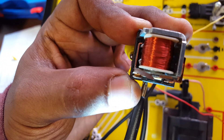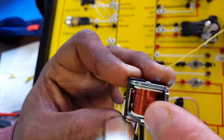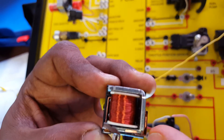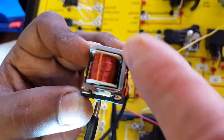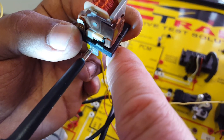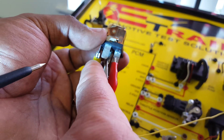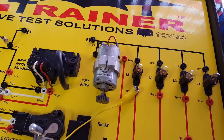That's the magnetic field being built up in the coil, pulling this in. That's the low current circuit. Pin 85 is the plus side — key power or powertrain control module side. Pin 86 is the ground. That makes the magnetic field. Pin 30 is the B-plus side — that is power to the high current side. Yellow 87 or 87a would go out to the load. One more time Kevin — that's how you can test a relay. Simply.